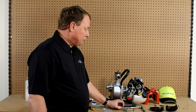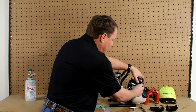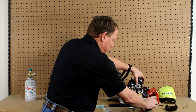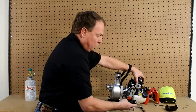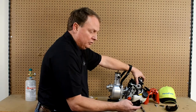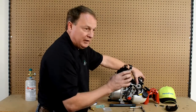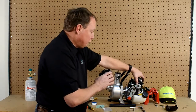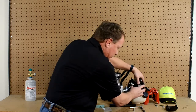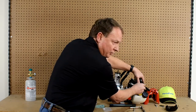I will show you how this all-field conversion plate is actually installed on the engine, which is extremely easy to do and anyone with a little bit of garage savvy can handle it. You would put this plate on the engine here and make sure your O-ring is in there. You will want to dab a little bit of silicon black sealant at this point where it seals together, so that when this starts to run it will draw a good vacuum. We will put the plate on and secure it with a couple of the supplied nuts that come in the package — they do not need any Loctite.